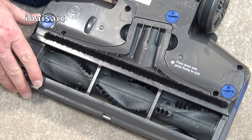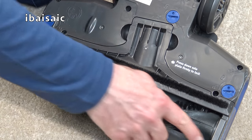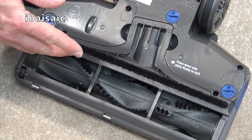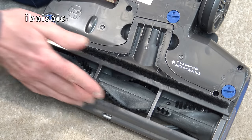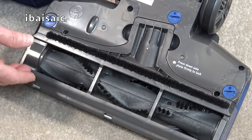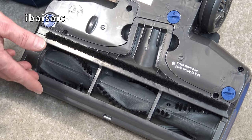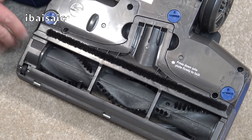Close the nozzle plate and do up the three screws. At this stage you can give the bottom of the power nozzle a wipe over. They can become very grubby — especially around the brush roll — with black or very dark brown encrusted muck all around the plate. When it builds up like that it can actually make the machine harder to push. So persevere — a bit of elbow grease and a good clean, then dry it. A little bit of furniture polish, buffed off, can help the power nozzle glide more smoothly over your carpet. If you do this regularly, maybe once a week or fortnight, it won't build up.